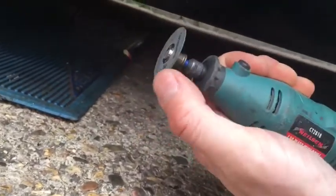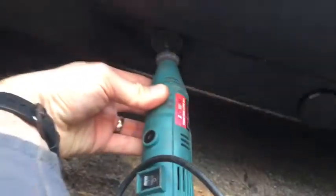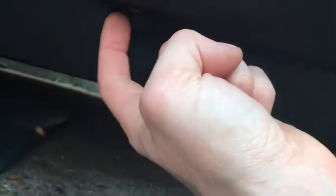I've used one of these so far and this is a brand new one. What I've done is gone into all 24 screws and, from this sort of angle here - you don't need to jack the car up - you can cut off half of the head. You can do it really easily with this tool, really controlled. Once I cut it off, just about to hit the plastic, I just got a screwdriver underneath it, lifted it, and it just pinged off.